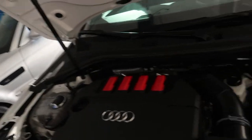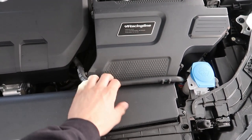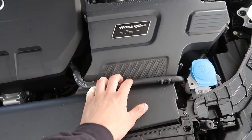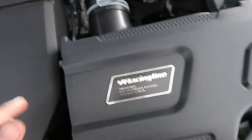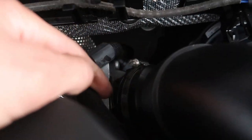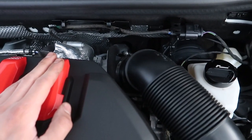Picking up where we left off in the last video — if you haven't seen it, go watch the unboxing and comparison with the old Mark 7 racing line intake hose. You can see how ugly this hose is compared to the nice air box. Still working on it — I might try to retrofit my racing line hose from my Mark 7R, but this nipple down here gives me a problem since it's larger. You can see where the inlet goes — looks like a T30 there. Should just be a couple screws and some clamps, pretty straightforward.